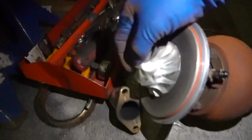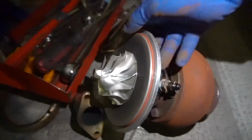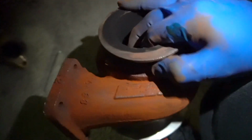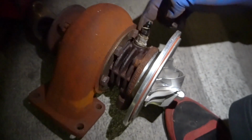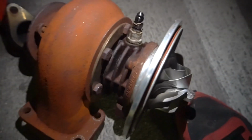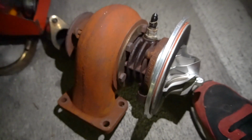Let's see if we have any shaft play. Nope, none at all. Now, I want to somehow flip it over, put it on my foot. No shaft play. That's crazy. It's just the cartridge that's leaking on this fitting. I don't know, what do you guys think? Leave a comment in the comments below.